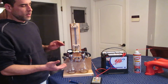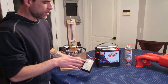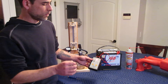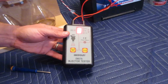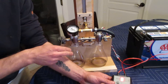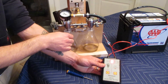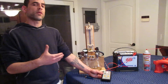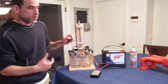The cool thing about having one of these electronic injection testers is it produces a totally controlled, consistent digital signal — exactly the same every time you hit the pulse. So I can hit the pulse five or ten times for one injector, then move the leads to the next injector and hit the pulse the same number of times. I can then compare how much fluid came out of each for the same number of pulses, giving me an idea of the relative flow rate of each injector compared to the others.